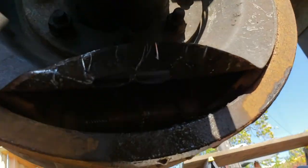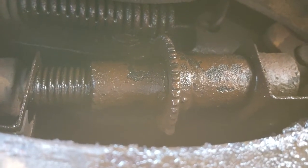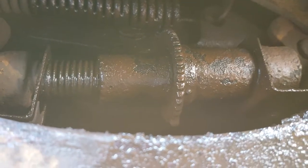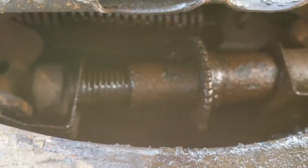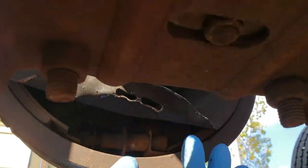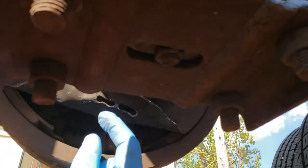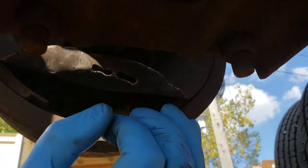This is how the parts look inside after bending the metal. There's a disc in the middle with ridges on the edges. We need to put the screwdriver at the bottom of the ridges and push from the bottom towards the inside, so that piece threads on the bolt to release the shoes on both the left and right sides. To remove the drum we need to reach this area and twist it to release the shoes.